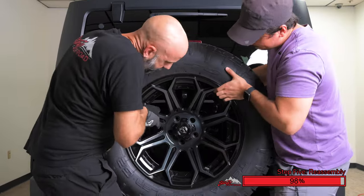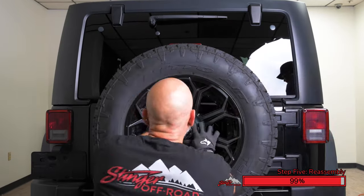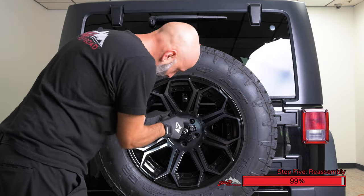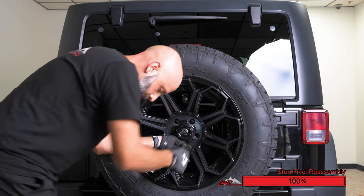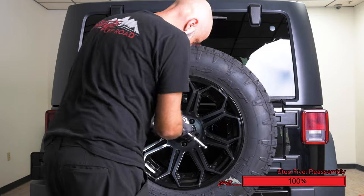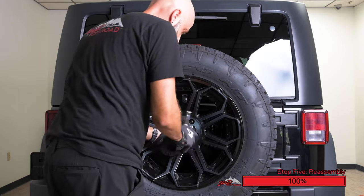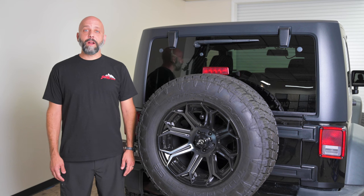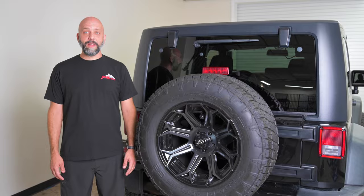Reinstall the spare tire — getting help from a friend if you need. Remember, safety is key. This particular wheel allows for a top dead center mounting of our camera. But if it didn't, we would position the camera as needed and then rotate the bracket to ensure that it's perfectly vertical. Well, that completes the install. We've now upgraded our Wrangler, taken away that factory mirror and installed a new mirror with an HD monitor. It has front and rear cameras and a built-in DVR. Be sure to check out our feature videos so you can see this product in action. We hope you've enjoyed this install video. Thanks for watching.